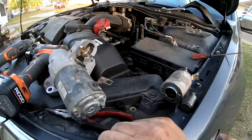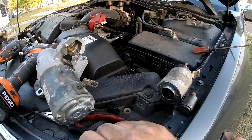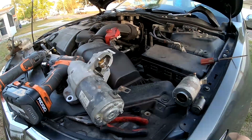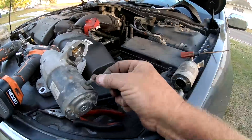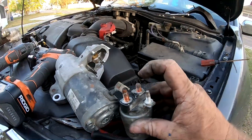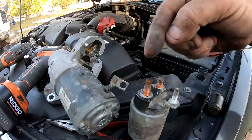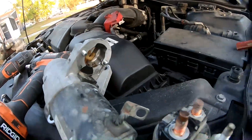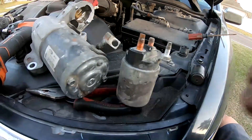This video is for people who are really short on money and in a starter situation where it clicks but won't crank. It can be a situation where it's not getting power through the wire from the battery to the starter itself. The solenoid bridges power from the main battery connection to the starter and pulls out the gear — but the problem is the contacts inside are corroded and not allowing power to pass.